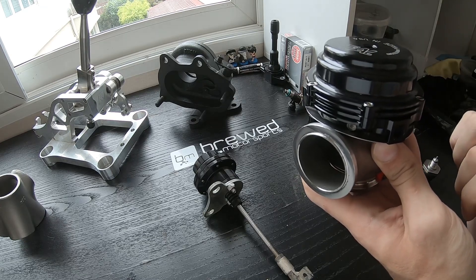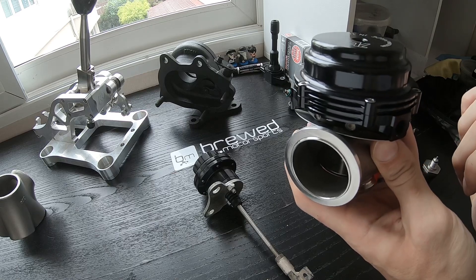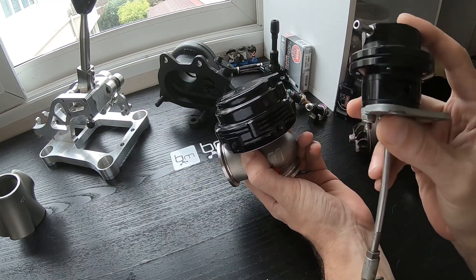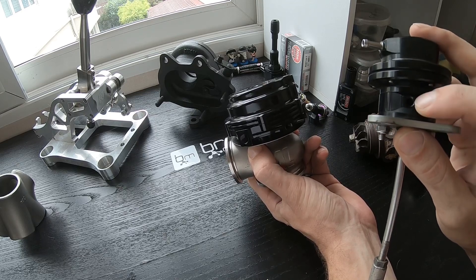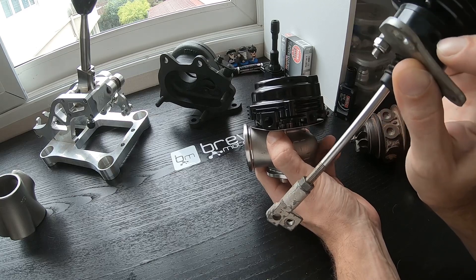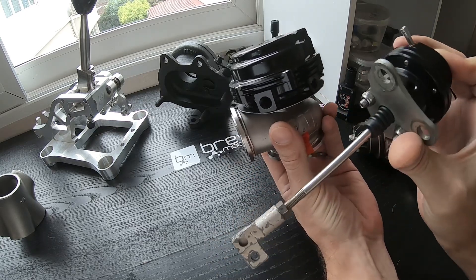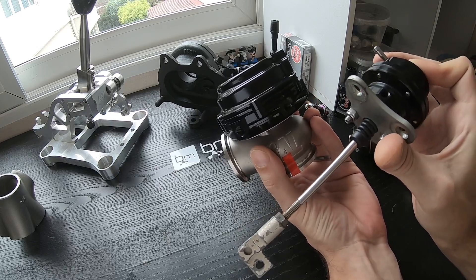This is extremely helpful and provides very good boost control. We normally use our VE four-port solenoids, which can get three, sometimes even four times the boost that you can get from just spring pressure — so they work very well. The common issue is many people with an internal wastegate actuator that has a top and bottom port get confused. They will run a boost reference to the bottom port only, expecting that to open the wastegate. This is not the case — this will in fact help hold the wastegate shut, absolutely causing an overboost issue. So just make sure you understand exactly how your wastegate actuator is working and plumb them accordingly. This is not something you want to find out by trial and error — you simply need to do it right the first time.